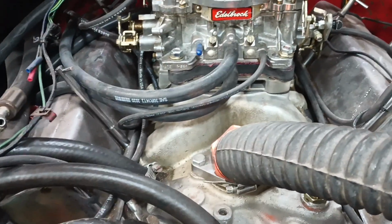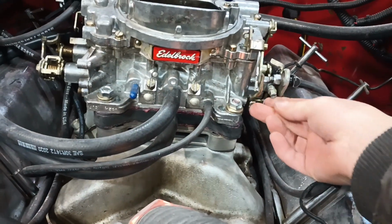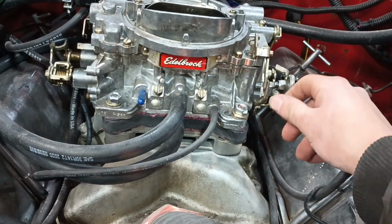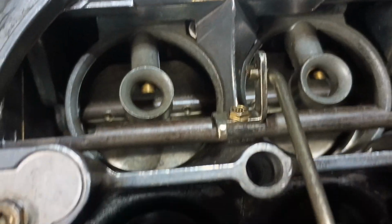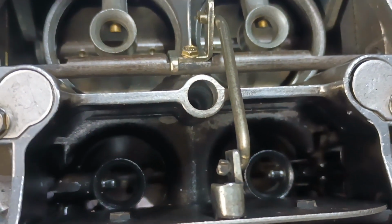Have an old hot rod with a big fat cam. Need to crank this stupid idle screw all the way in to get the damn thing to idle to where the transfer slots are exposed. Well, one, that's wrong. Two, what you need to do is go over here, flip your carb upside down, and drill a couple holes in your throttle blades.